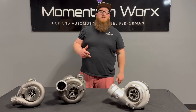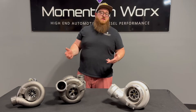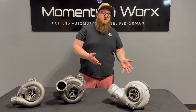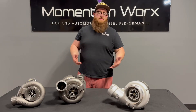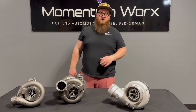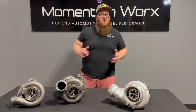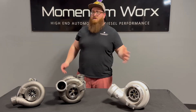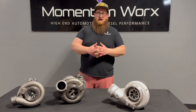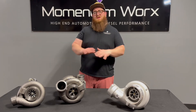Online, you'll see a lot of people throw hate about taking your compounds off and going to a single turbo. They'll quote things like compression ratio, saying if you go to a single turbo you have to drop from the factory 18-to-1 to 16-to-1. While 16-to-1 pistons would be a good idea if you're doing an in-frame anyway, you don't have to do that. You can run a single turbo on an 18-to-1 compression piston setup motor. The motor doesn't know how many turbos are feeding it — whether it's two, three, seven, or one. So as long as you're not cranking the boost up like crazy, the 18-to-1 pistons with a single turbo setup is completely fine for the average working truck.